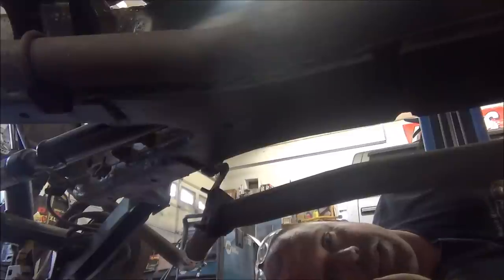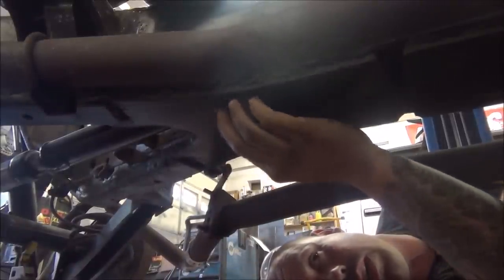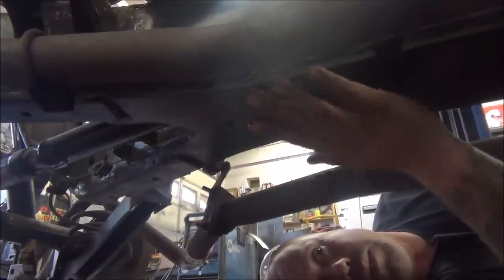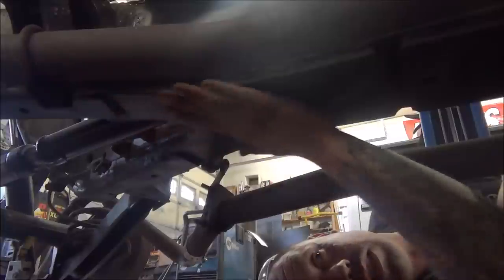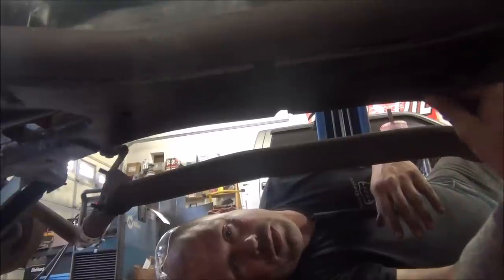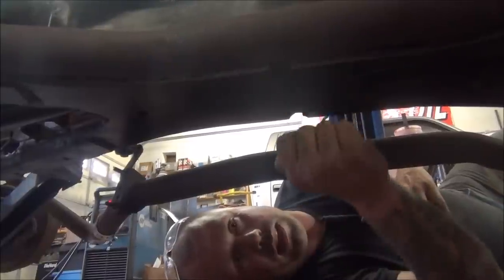For those of you with '60s model Impalas, one thing you run into is when trying to raise the rear end with 12-inch cylinders or bigger, your driveshaft is going to come in contact with the lower portion of the driveshaft tunnel. What we do is cut out the lower portion of the driveshaft tunnel to allow the driveshaft to go below the frame — that way you can get full lockup. But you need to reinforce it afterwards. The entire bottom of where the X meets in the frame is a very flat area, so it's a good place to put a piece of plate steel. Just make sure you keep the area where the carrier bearing bolts are open. You do not want to box that in, because carrier bearings don't last forever, and you want to be able to access those bolts to remove the carrier bearing inside the driveshaft tunnel.